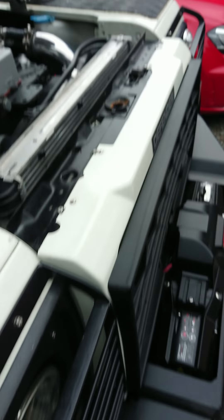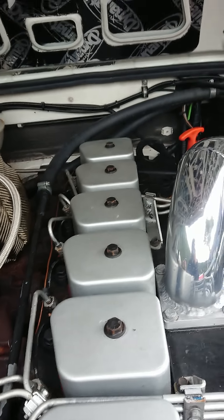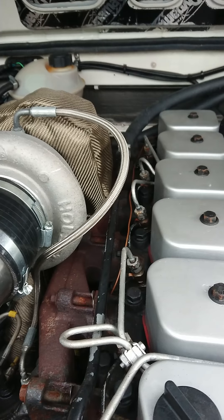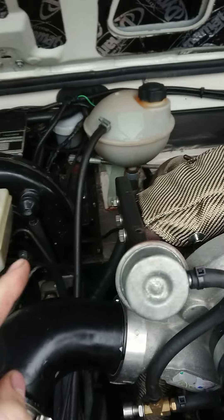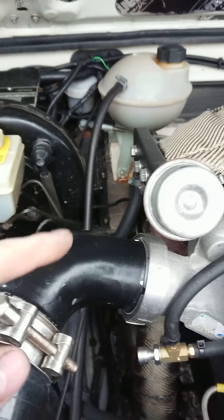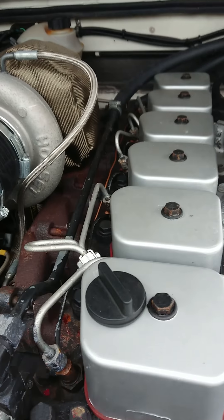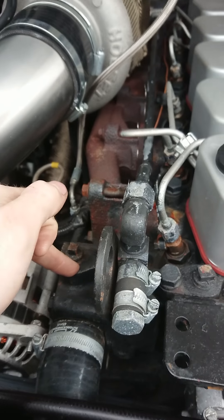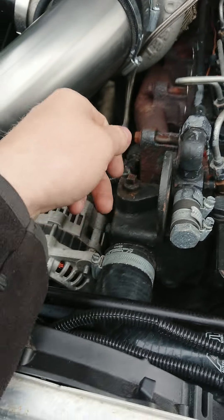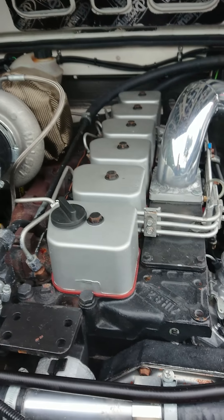The heater matrix is a big debate always on the Cummins Land Rover group on Facebook — if you're not on it and you're thinking about doing one of these conversions, you should be. I have mine on the closed side of the thermostat, so whenever the thermostat is closed it's feeding the heater matrix. Then the heater matrix feeds out, goes into just below the header tank, and basically the water pump draws circular flow from the header tank back down and up around the heater matrix. When it opens it just bypasses that — it works really well. If you use what comes on the DAF lorry — a port here and a port here — and basically plumb your heater matrix in, you'll get very little flow because you're just relying on the pressure difference, and it's not really that much, especially when the thermostat opens.